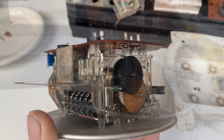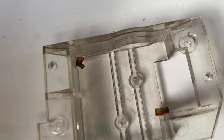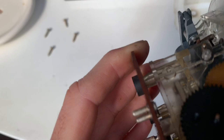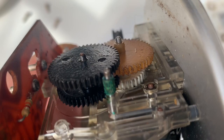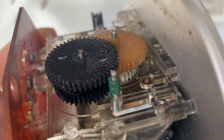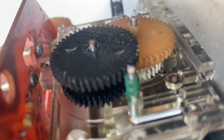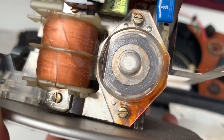In theory, if they've sent us the right cog, that should be it. That cover comes off — it's just held on by two screws, just lifts straight off. I'm holding it up this way just so those cogs don't fall off, and if you look inside there you can see just the remnants of the old cog. There's the new cog and we're going to try and fit it onto there, but whatever that green stuff is it's going to have to come off, because it looks like the hole in the cog is just big enough to fit over that shaft.